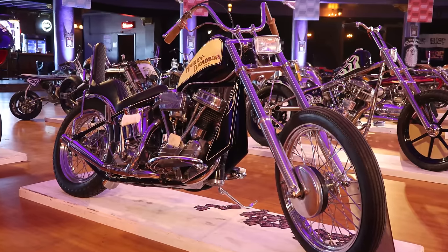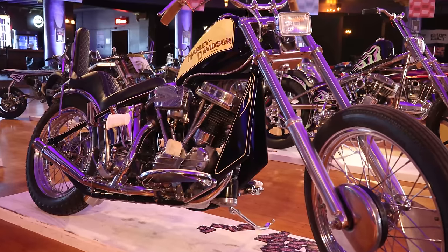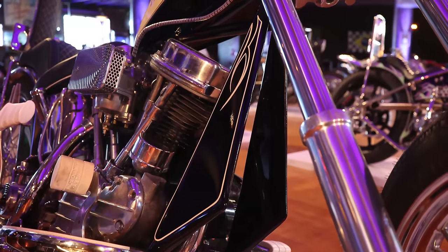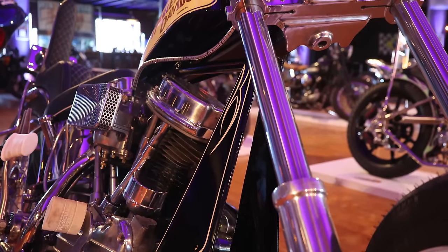And when I got it, the lower legs already had those triangles on them, on the frame. But I completely redid them. I was debating whether to knock them off or just go for it. Usually guys cut off those sidecar loops on the bottom. So these were already cut off, and that's why the triangles went on there. So I decided to keep them. And I really leaned into it, redid all the Bondo on it, and really kind of brought it back to life.